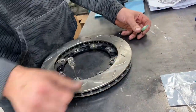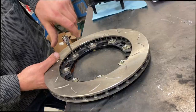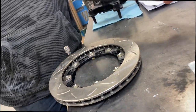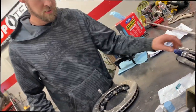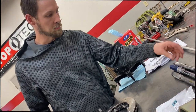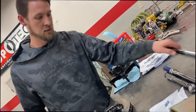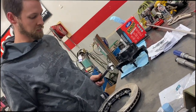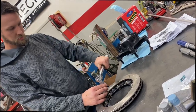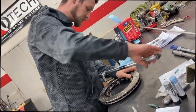These are to be torqued to 67 to 72 inch pounds. Now that you've got them all started, it's 67 to 72 inch pounds — you can divide that by 12 and that would be 5.5 to 6 foot pounds if you don't have an inch pound torque wrench. This is a massive torque wrench for this application.